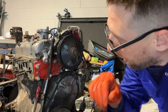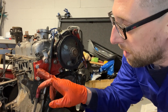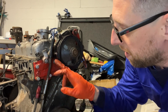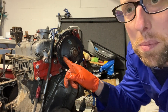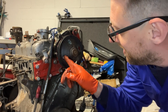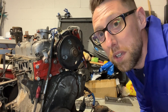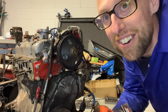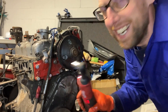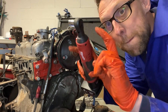Right, water pump. I believe there's six bolts here and then there is a hidden seventh one just in here. That should take off the water pump. It's quite gone. Loving these tools by the way — don't know how long I can borrow these.